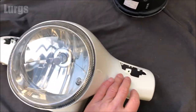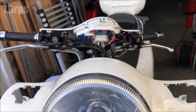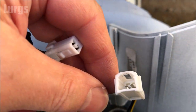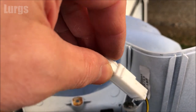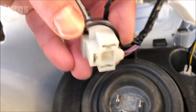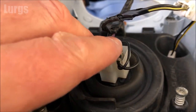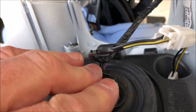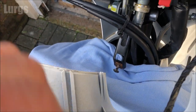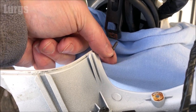This is ready to go back on the Vespa. I'm just going to rest it on the top of the horn fairing and plug the bulbs back in. I'm going to plug the parking light in first — this can only go in one way, just push it all the way in until that clip pops through. Then the main headlamp bulb — again this can only go in one way, just push it on all the way down till it's nice and firm. I put the screw for the headlamp fairing back in earlier just so I wouldn't lose it, so I'm just going to quickly remove that.